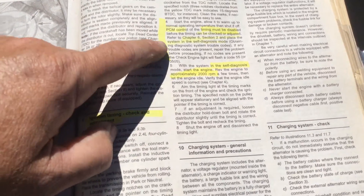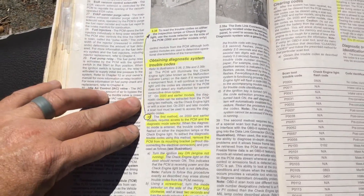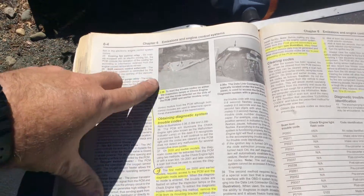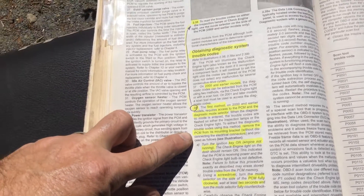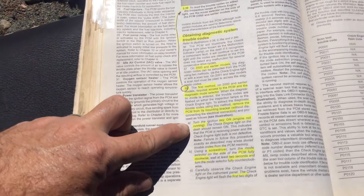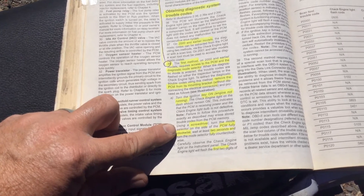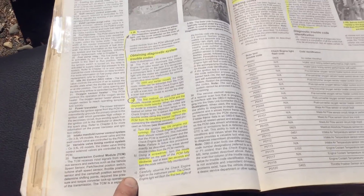What that involves: you go to section 6.2 in the manual and it tells you how to do it. You have to access the PCM, then turn it clockwise and let it sit for two seconds fully clockwise — with the ignition in the on setting but with the engine not started. Then after putting it fully clockwise for two seconds, you put it back counterclockwise, and it gives you the engine codes. I did that, and it worked.